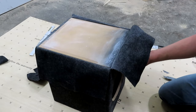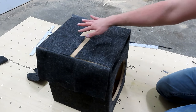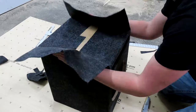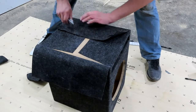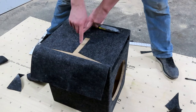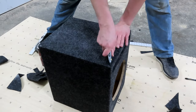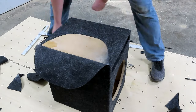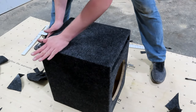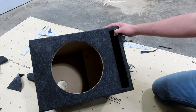Start by rolling the front side and back side just like we did the other side. On this side we actually get the seam to line up nice and pretty. Cut the excess off the edges and then fold the sides over. On this side there are some spots we missed — want to cover all that — so the smiley cut is going to have to come all the way around. Flip it down, make sure you get it into all the seams. That's it — that's a completely carpeted subwoofer box. Let's put that terminal cup in and see what it looks like.